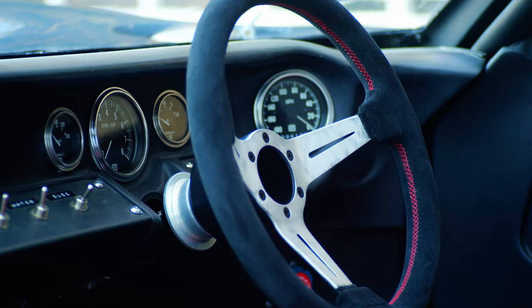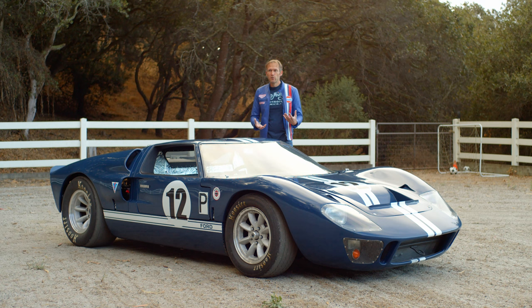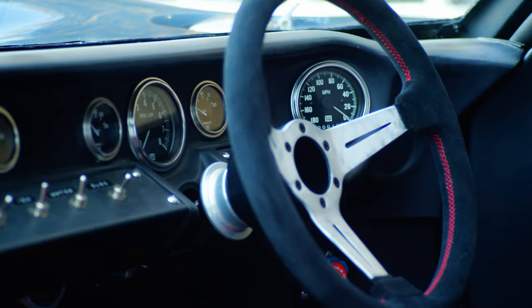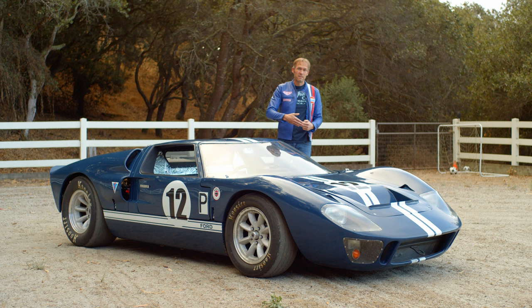I also stiffened the attachment points for the steering column under the dash — it had a little bit of flex, so I firmed that up. I finally added a speedometer; it's a GPS speedometer so I didn't have to wire anything to the gearbox. I'm a little conflicted — I don't think race cars should have speedometers — but I was calculating speed using revs and gear ratios and tire diameters, and it filled a space I had in the dash.